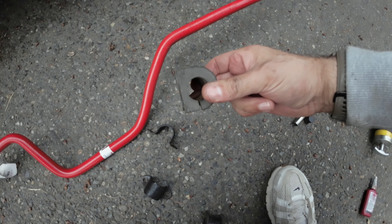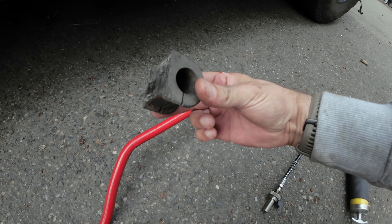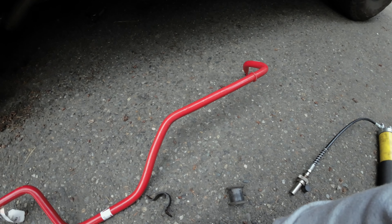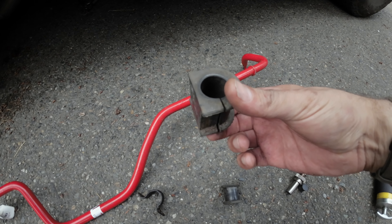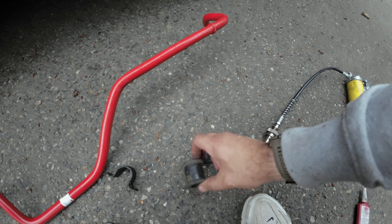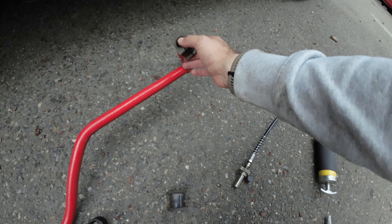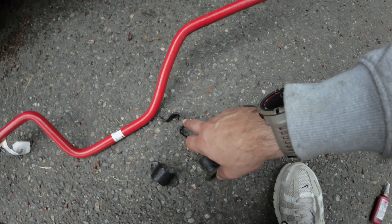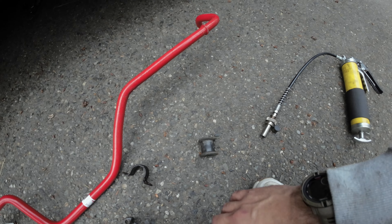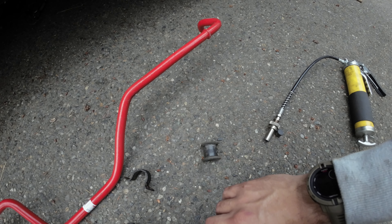One thing we're also going to do is grease the inside of the factory sway bar bushings. I didn't get new bushings — these look fine, they don't look cracked, just a little dusty, but totally in good shape. So we're going to throw some grease on the inside with my good old-fashioned grease gun, throw it on the outside of the stopper, pop it on, and then throw on our sway bar bushing brackets, and hopefully see if this will hold its own weight back in the vehicle with the threads that I just tapped.